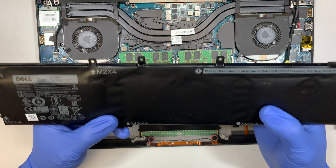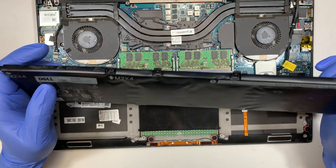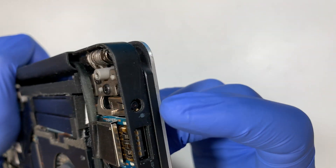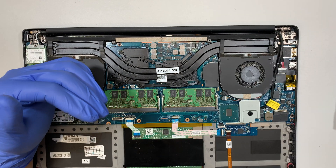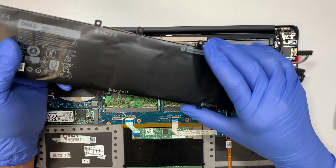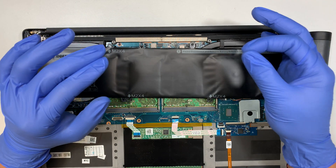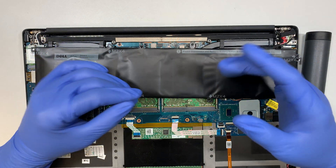If your battery died prematurely, I can tell you almost certainly 90% of the reason why: you had the charger plugged in 24/7. These are smart batteries with a cycle count, and leaving it plugged in all the time causes the battery to die very prematurely. What I recommend is: when you use the computer, plug in the charger; when you're done in the evening, unplug it, let the computer shut down on its own, and plug it back in the next day when you need it.